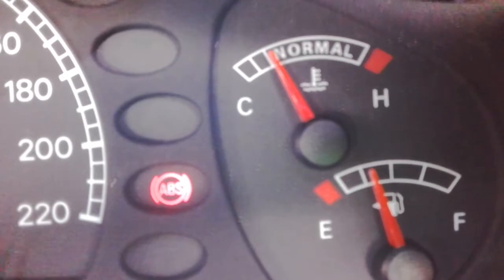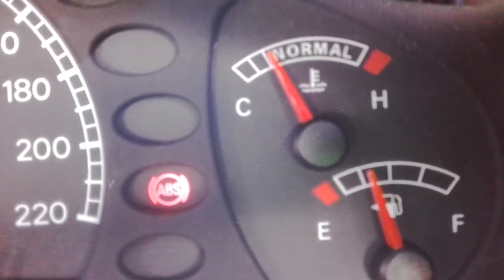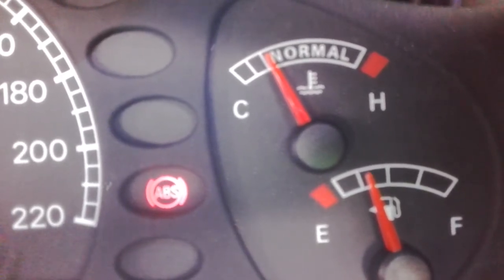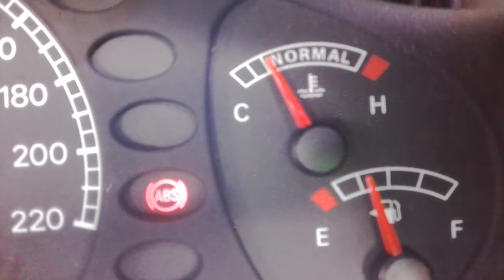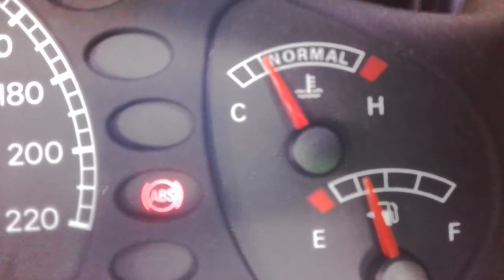That first graduation before the end is around 70 degrees. With this little adjustment, it turns on the fan at 74 degrees. It'll cool it, so it'll start climbing up to about 78 then turn back off at 74, keeping your engine temperature around 74 to 80 degrees roughly.